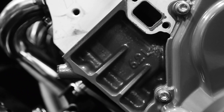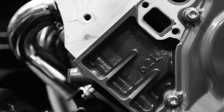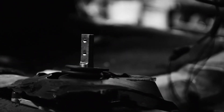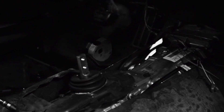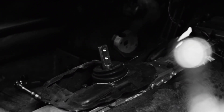Running on pump gas — it's got 94 octane fuel in the cell. Conservative on the timing, it's going to work perfectly on the street without having to worry about octane boost or anything like that. It's got 659 horsepower, and the peak power is at 7,600 RPM. It's still making 645 horsepower at 8,000 RPM, so it's still hanging in there. The torque was 462 pounds of torque at 7,100 RPM — even that number being so high up in the range is interesting.